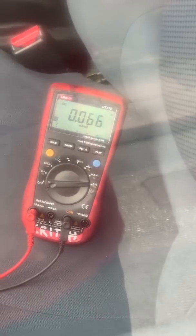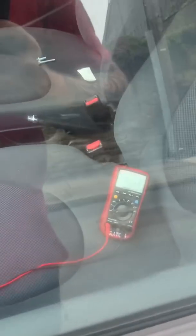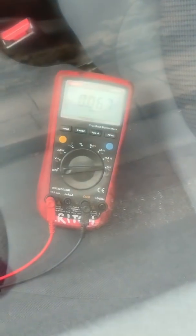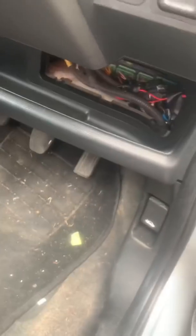As you can see, with the car locked, we're getting 67 milliamps. For this particular age of vehicle, that is a lot higher than we'd want, so we're going to have to do some testing into what's going on. We know we've actually got a drain. What we've got to do is access the fuse box - on this car we've got one inside here - and we need to have the car locked.